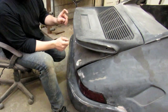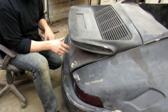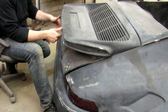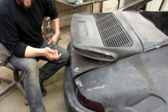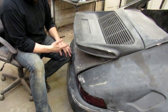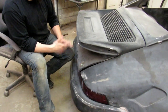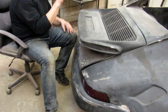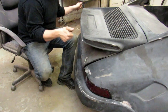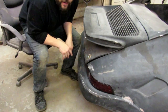The only problem is this is fiberglass and I'm going to make it out of metal. So I'm going to make a metal form and then fiberglass it to it. I tried to buy a used one from a couple guys — they couldn't drag them down, or they had the wrong ones, or they were broke or whatever. I've been waiting on a spoiler for almost two months now and I'm not going to wait anymore. We're going to just knock one out. I need to make a form around this first, then I can take my form over to my plasma cutter and start cutting out the metal and see what the shape looks like.